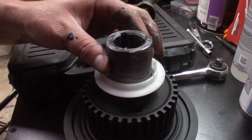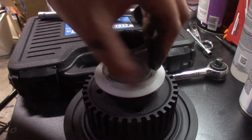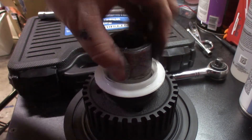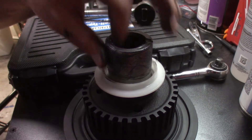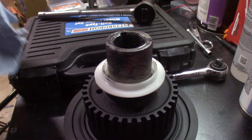It doesn't have to be too much, but that should do it. Grease also helps so that when it hits the seal it doesn't crack it or rub it the wrong way. Ford says you need a special installer to install this, but I don't think that's completely accurate — I think we can install it just with the bolt and maybe a little tap to get it started. We'll get over to the car and get this thing back on.